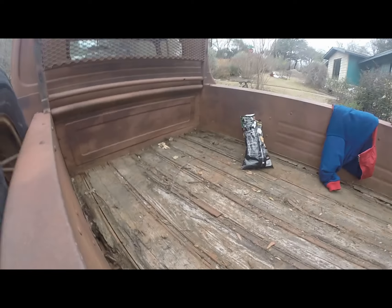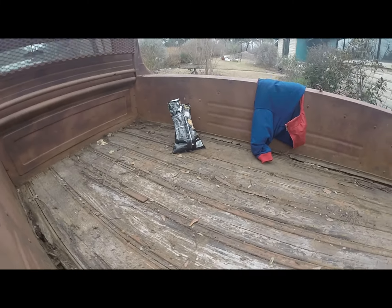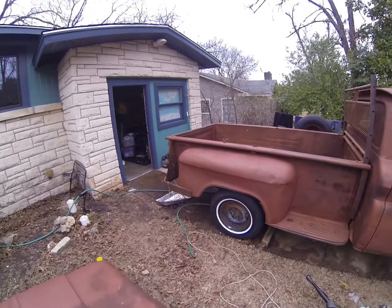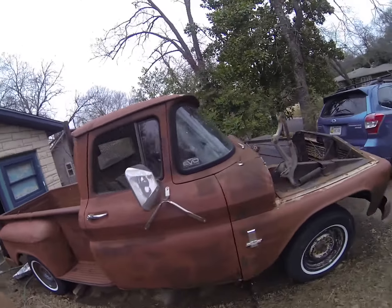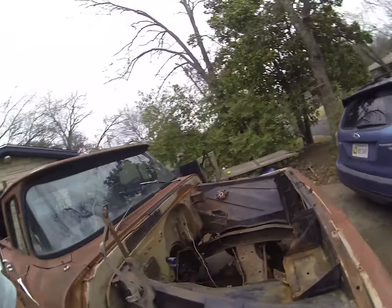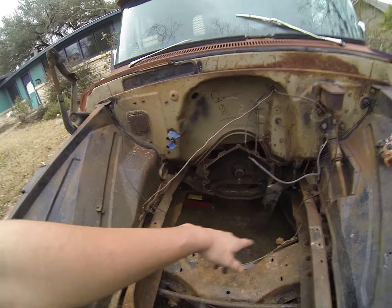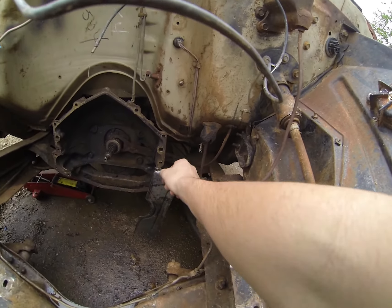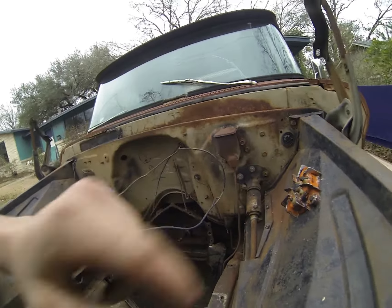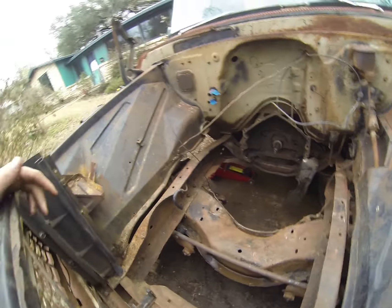You can see the bed right now — the wood's all rotting and falling apart, so we got brand new wood and brand new metal that goes in between. It should look really good once we're done. Now I'm going to get started on the engine bay. Here's our red 1963 Chevy — it's red but it's got a little surface rust in some spots and the paint's really faded; it's got a patina look on it now. So we pulled the engine — there's the original 4-speed in it, that's the original throwout bearing, it's just pulled with the clutch lever. Ours is hydraulic so we'll have to figure out how we're going to do that — probably going to have to throw in an extra master cylinder. So today we'll be getting all the rust off this engine bay and starting to paint it.